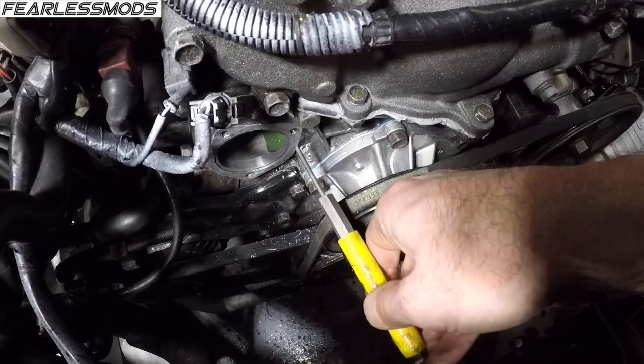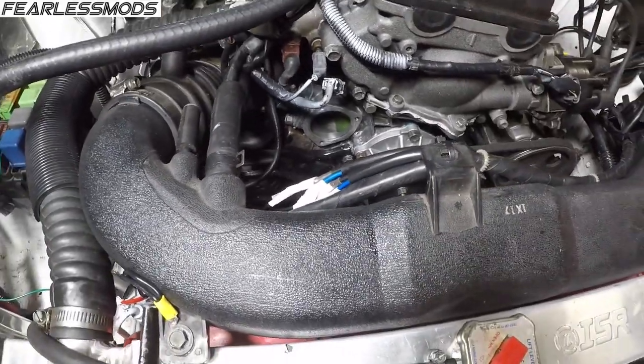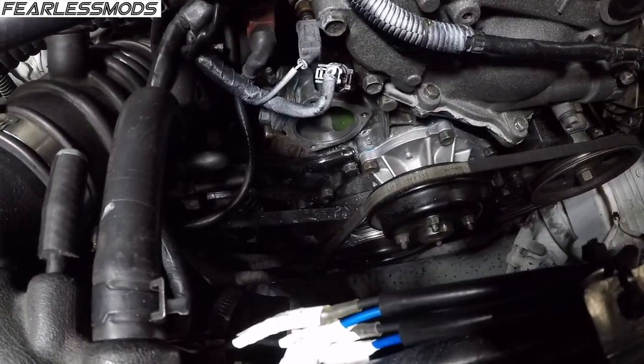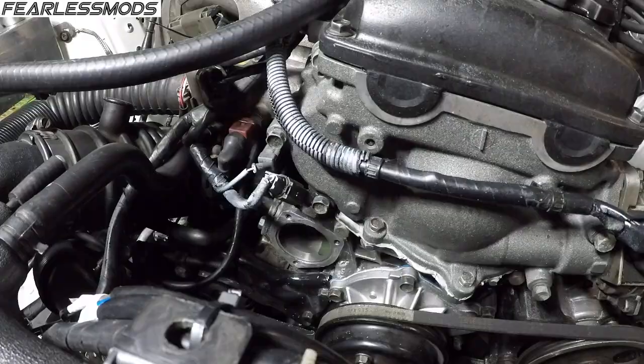But this, I've already pulled out some pieces of metal shavings off the end of the punch there. It had a little bit of magnetizing to it, and so I went ahead and cleared that out, and so it's good to go. The reason I want to wait for it to dry is because I don't want to put our bolt in there and then have it thread locked into that, because then next time we go to back it out, it'll just pull the helicoil with it, or try to at least, and then end up being a terrible mess. So I'm going to give that a little bit of time, and then we'll go ahead and install it.